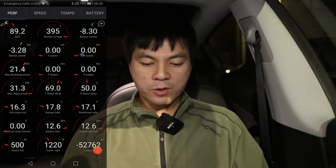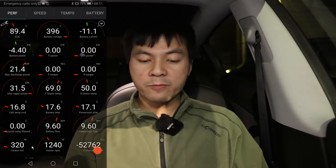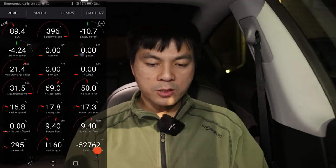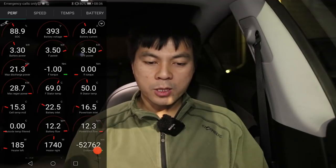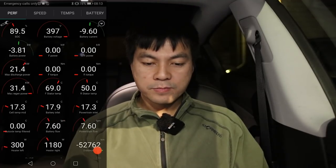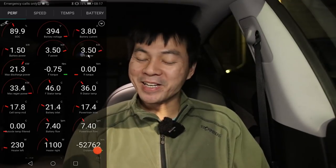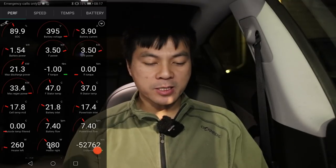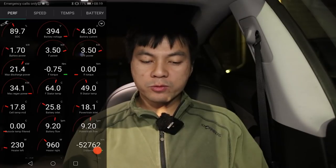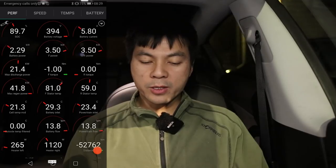After about 10 minutes, the heater is already resting at 1.5 kilowatt. But the afterburner shuts down after only five minutes — then it wants to prioritize charging back to 90%. Once it reaches 90% again, it fires the afterburners again. The car cycles: run afterburners, drop state of charge a little, then shut down afterburners to charge back up. Maintaining the desired charging level is very important — more important than heating up the battery.